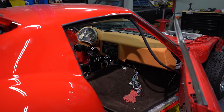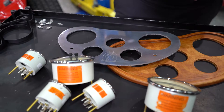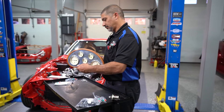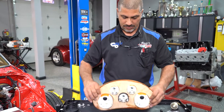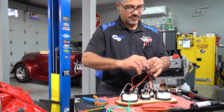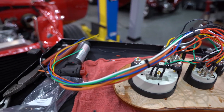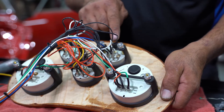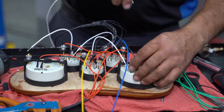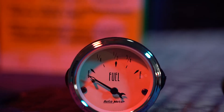Jay made me a nice aluminum bezel to go in front of a wooden background. I've got five slots: RPM, speedometer, and the three most important ones after that are oil pressure, coolant temperature, and fuel level. If you have extras on the side, you can use voltage, oil temperature, and even fuel pressure. As you can see on the backside, I pretty much made my own pigtail — I put all the grounds together, including the three light grounds on the little gauges. White is going to be RPM, black is ground, red is power, yellow is fuel, green is water, and orange is the pickup for the fuel gauge itself.